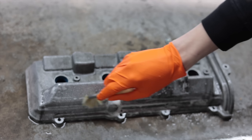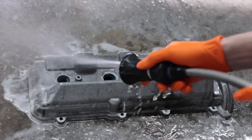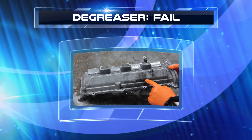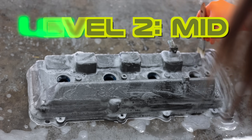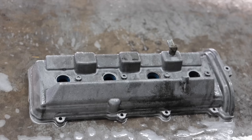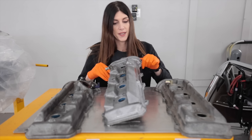What I don't want to do is stain this, because I don't know if this is just pure aluminum or if it's got magnesium in it, and if it does it's going to turn really dark. So that did pretty much nothing. You can see this has got stains on it already, so I need to brighten this. This is actually fallout cleaner for brakes, and sometimes it can pull off miracles depending on what kind of stains are on something. So this is after the citrus degreaser and then some fallout brake cleaner — it's brighter, but still not good.